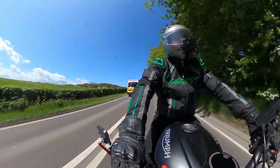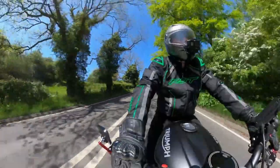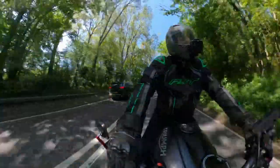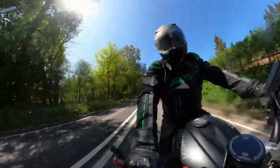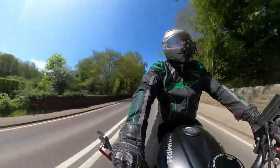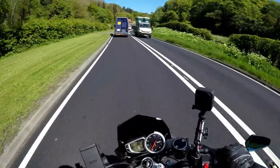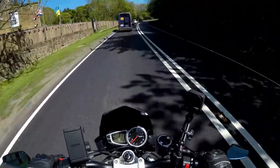Talking about suspension — the rear has a single shock. The good thing about the R model is it's very adjustable. Same as the front, you've got rebound and compression adjustments front and rear. I've actually got the back softer than soft, because on really bumpy roads it's just like a buckaroo. However, when there's two-up — which is quite a lot — it's a little bit too soft, so you do have to adjust the suspension when you've got a passenger. And of course, if you take it on a track, you'd need track settings. But for single-rider road use, the soft settings are pretty good — I'm happy with them.